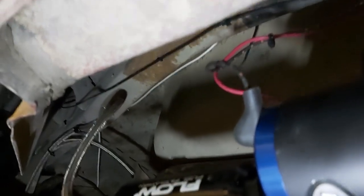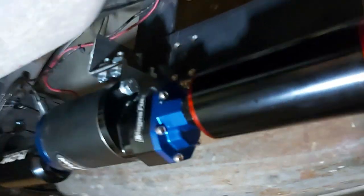Right now I've got it triggered with a white wire — that's a key-on signal — just to test this system. I tested it and I'll put a scene in here where you can see 60 PSI at the rails, which is what we need to run the Terminator X-Max ECM. The instructions say you've got to have a return fuel system, and this is what we've got.